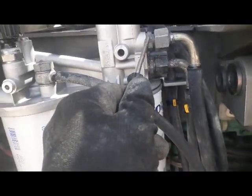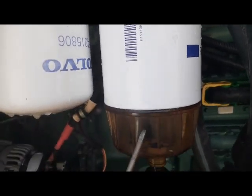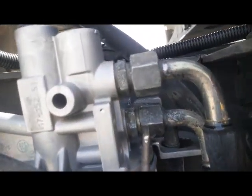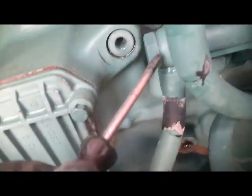Fuel comes down this side, and here water is separating from the fuel — if there is water, it is separated from here. Then fuel comes out from this port, which is the pre-filter port. From here it goes through this hose, and here one is ECM — also a fuel cooling system.